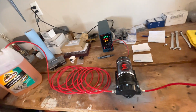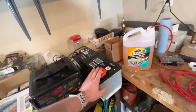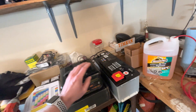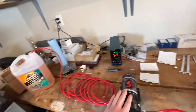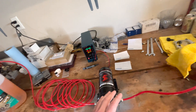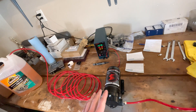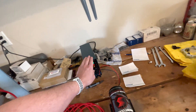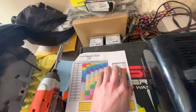I also checked Ohm's law on this: putting in 13.8 volts with a measured resistance gives me 9.6 amps right on the ball. I also tried using a fully charged 850 amp battery with a charger at 13.8 volts and 12 amps — the flow was exactly the same. Even increasing the amperage doesn't change results. Using the AC/DC converter just means I can get exact apples-to-apples comparisons between each nozzle without depleting a battery.